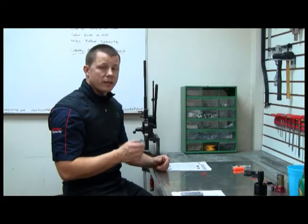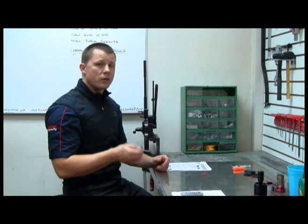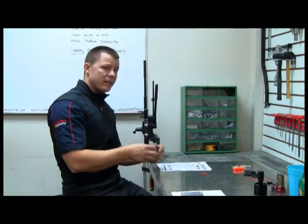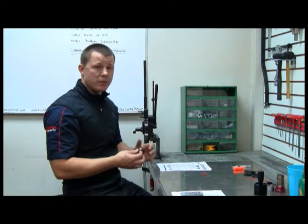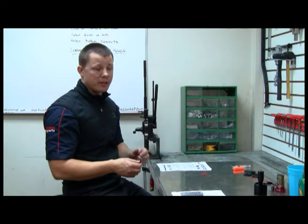Now that the seals are off, I can clean the bearing. We use a simple green solution that's diluted in water. You don't want to use any solvents and especially not kerosene because that can be very corrosive to the bearing races. Once it's cleaned, I'm going to let it dry and give it a spin to feel for any grit and roughness. That's usually a sign it needs to be cleaned again, but if it's really bad, it can be a sign that the bearing races are damaged and the bearing is going to need to be replaced.